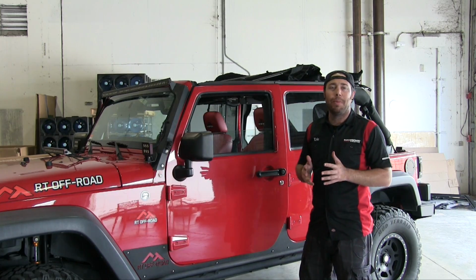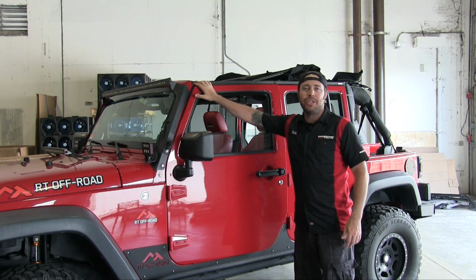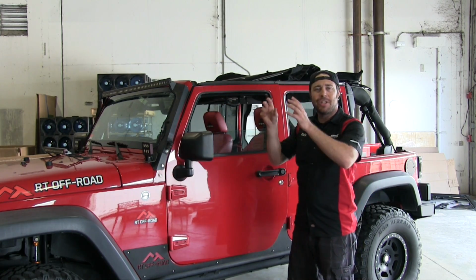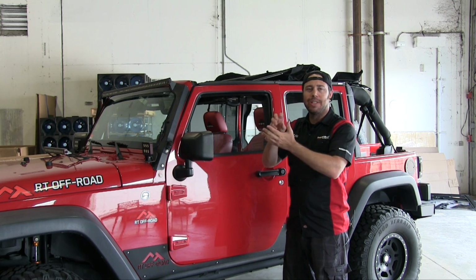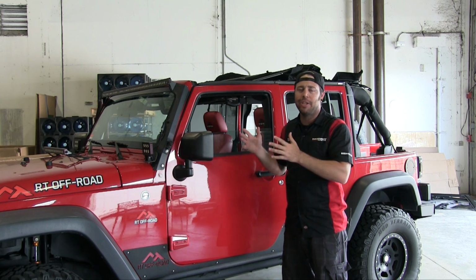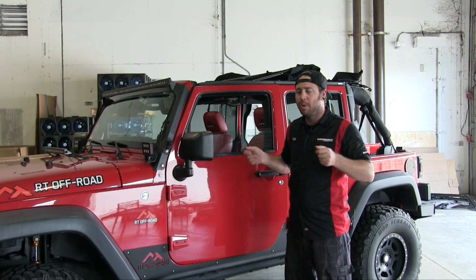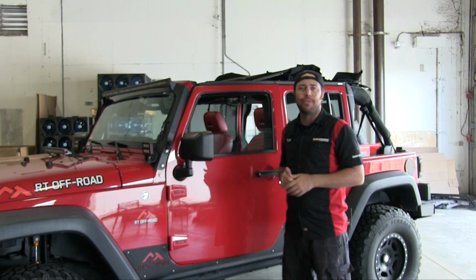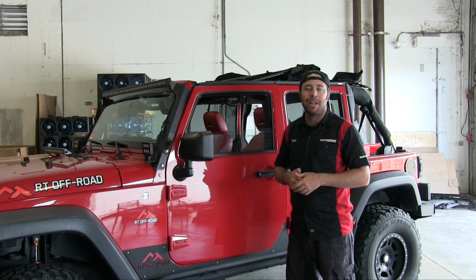All right guys, so we're almost done. All that's left to do is move the Sunrider to the forward position, and what we're going to do is attach the latches to the windshield frame, but we're not going to lock them down tight. We're just going to attach those. That'll give us enough pre-tension to be able to get the rear windows on, and then install the tailgate bar. Once that's into place, we lock down the front latches, and we are home free. So follow me along as I do all that for you.